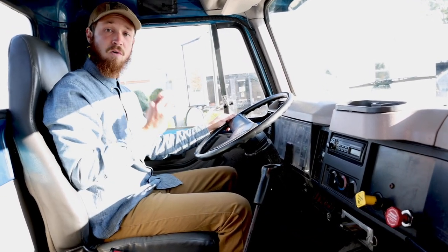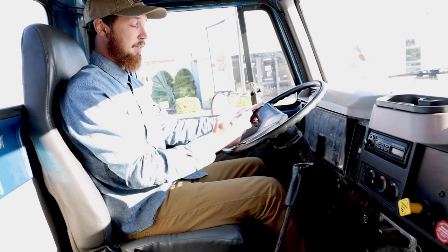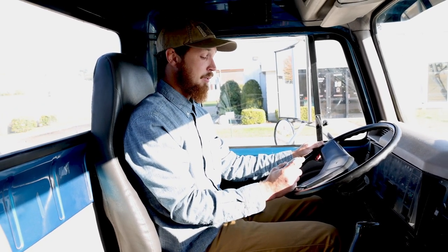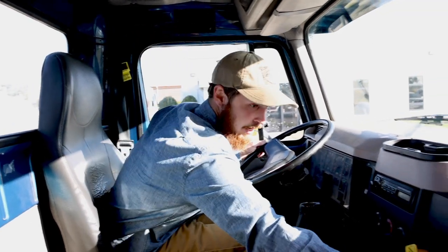Bring a timer or a watch with you so you can count your minute. I will press and hold the brake pedal for 1 minute, making sure I do not lose more than 4 PSI in that minute. I got my timer here, I will count the minute. So for practice sake, I will call that a minute, and we haven't lost more than 4 PSI.